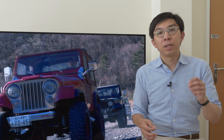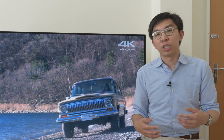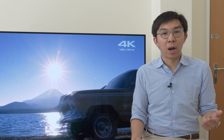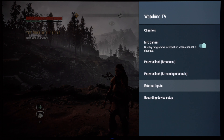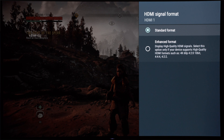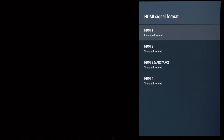For gaming, input lag measured 26ms in both 1080p SDR and 4K HDR game modes. While this figure is probably responsive enough for all but the most hardcore Twitch gamers, it's the absence of HDMI 2.1 gaming features — such as Auto Low Latency Mode (ALLM) and Variable Refresh Rate (VRR) — that will steer gamers away from Sony and towards LG and Samsung. To get your Xbox One X and PS4 Pro to send out 4K at 60Hz HDR to the Sony AG9, you'll need to go into the TV's user menu and change HDMI signal format from standard to enhanced.